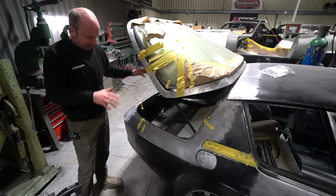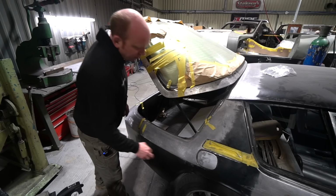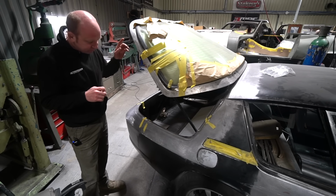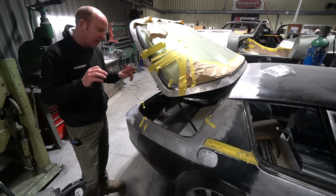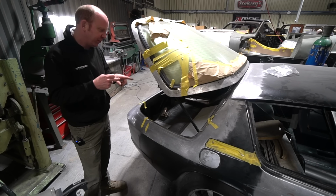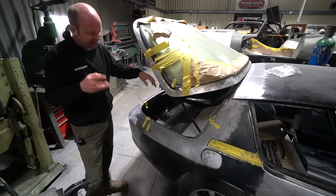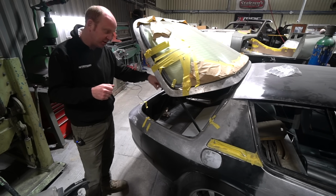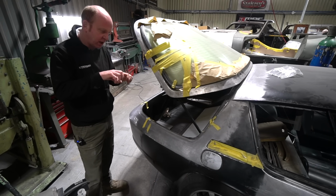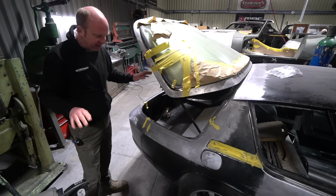So to that end, quite a bit of the rear end of the car was re-engineered to allow a larger fuel tank, and one thing that was done was moving the fuel filler, which is why it's now up here and not low down on the other side like it normally is on an interceptor. However, the way this had been done, we weren't very happy with. The fuel filler pipe had been put through and came through into the boot area, trunk area, and back out of the trunk area through a closing panel and down to the fuel tank. And it meant there were Jubilee clipped junctions in the fuel filler inside the car, and I'm not at all happy with that.